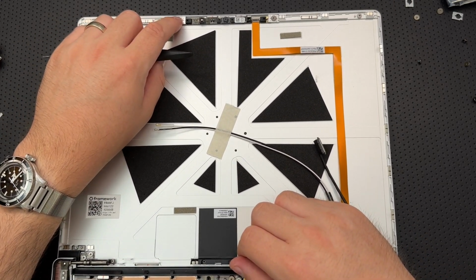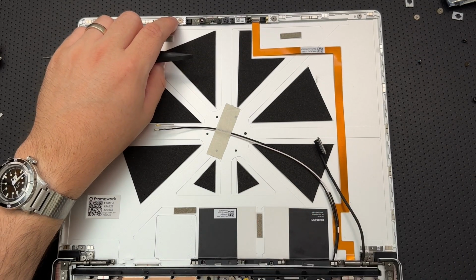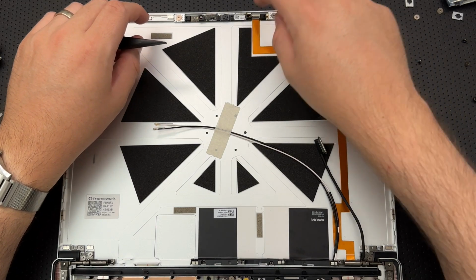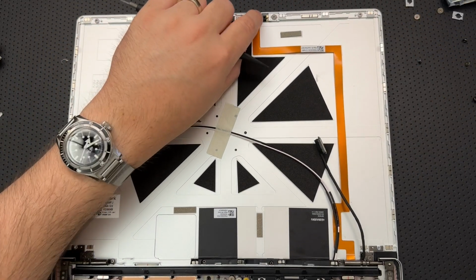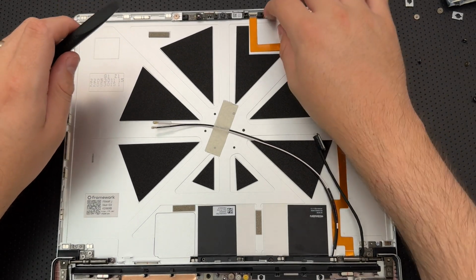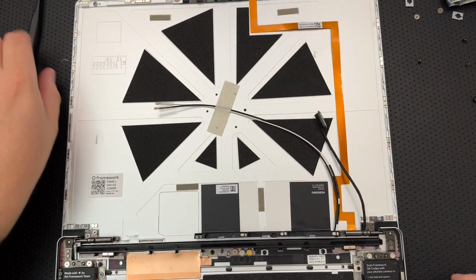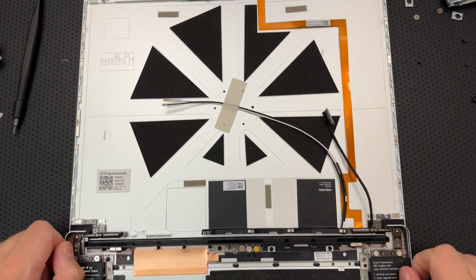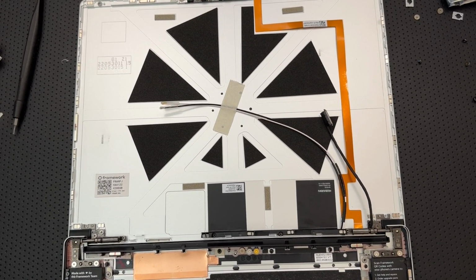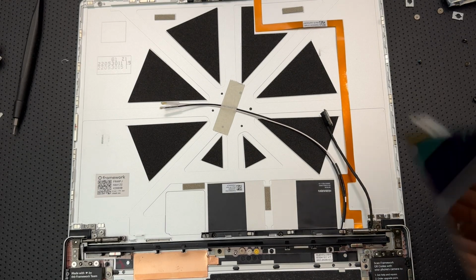Okay, that's fine. This all looks good. Beautiful. This is connected. The black latch is down. Do not over tighten the fasteners. Yeah, looks good. Reinstall the display. Okay. Four alignment pins. You should only handle the display by this side. Don't over tighten the fasteners. This I can do. Got me a display.